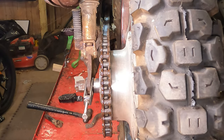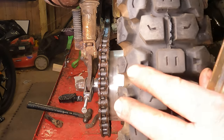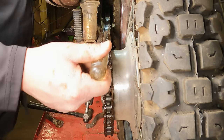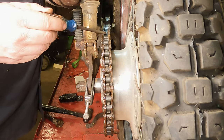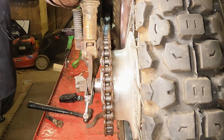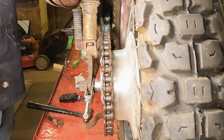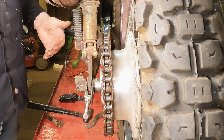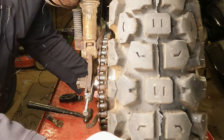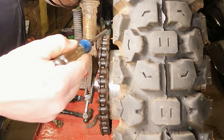Hopefully you can see this. Where the wheel sits right now, the chain is fairly well aligned. When your chain is extremely misaligned, it's going to look something like that. If you put your eye to it back here and look up the chain, you should be able to see it pivots or there's a curve right around here, then it gets straight and goes all the way up to the front sprocket. You can't really see the front sprocket and that's okay — if you can straighten out this angle right here, the front one will straighten out too because they move at the same angle. Too far to the left, too far to the right — you can see how it pitches.